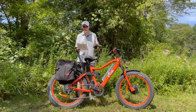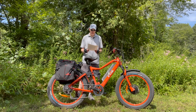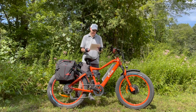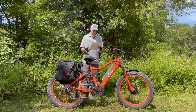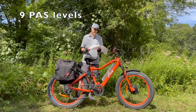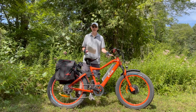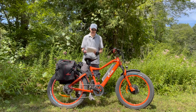With dual motors, it climbs like a billy goat and goes places other bikes can't go. The controller is a 52 volt sine wave 45 amp controller — lots of power. It's got cooling fins to aid in heat dissipation. It's IP65 waterproof rated. They actually make a hunting version that comes in camouflage, so if you do any hunting you can take this with you.